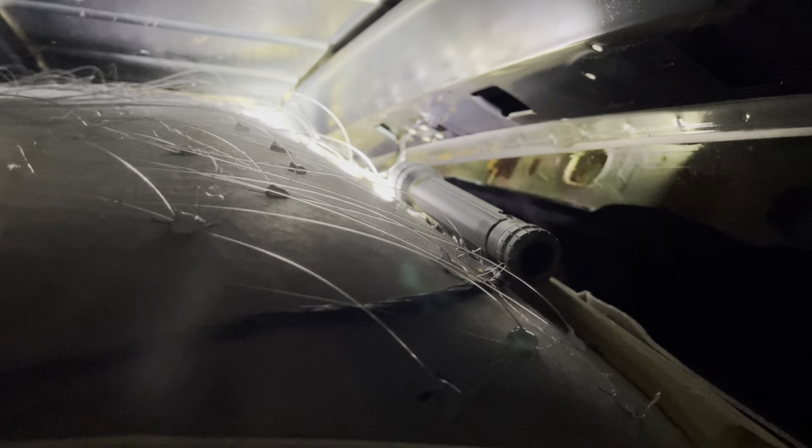If not, then you're going to have to try to grab a hook and catch that wire through that little hole, because there's a plate on that side that blocks that whole spot to look at the headliner from the third brake light. So make sure you do that. Then you go ahead and grab it from the other side, plug it in.